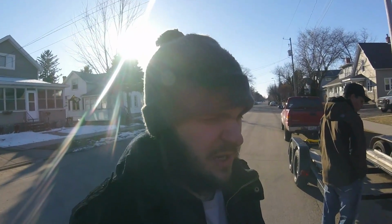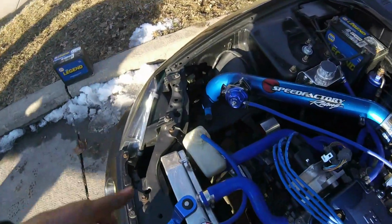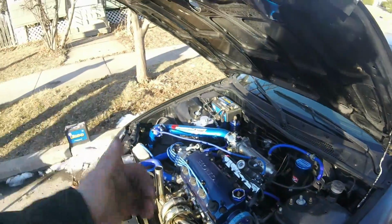Alright guys, so we had some issues with the car running a little bit hot. The Hondata actually threw a check engine light, because normally on a Hondata it'll be set up so it'll throw the check engine light if it gets over 210 degrees, which we were sitting idling for a long time, and he did not have the fan wired, so we just wired the fan up and got it cooled back down, and hopefully no more overheating.